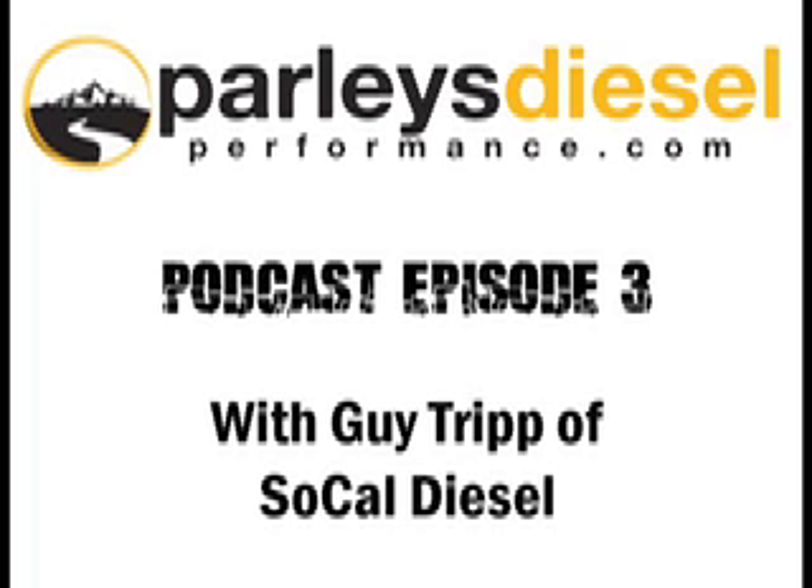We deal with a wide range of customers — anybody from the guy that's just looking to increase his mileage and maybe a little power to towing, to the professional racers. In dealing with the racers that are doing a lot of sled pulling and drag racing, we've identified a lot of the weak points in the Duramax engine. These happen at very, very elevated power levels. One of the things we ran into is I started to see increased incidences of broken crankshafts.